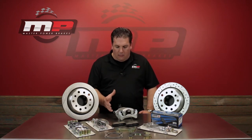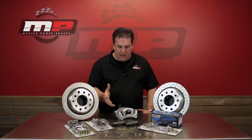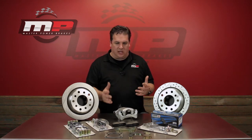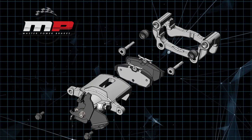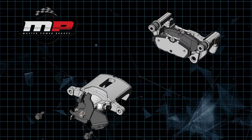What we've chosen for a brake caliper in our new rear systems is this one right here. It's a more modern type of caliper — actually used in some late model Ford applications, and similar to some GM stuff. It's the same design that fits in a lot of different areas. It's a single piston floating caliper with a really nice steel cast iron bracket for mounting, which keeps the unit very rigid. It's a slightly smaller piston in the caliper, so it's going to balance well with the rest of the brake system.